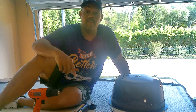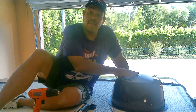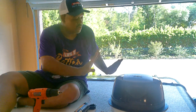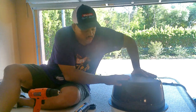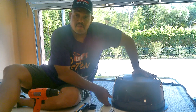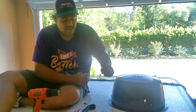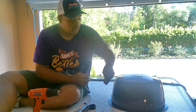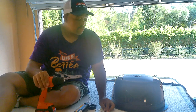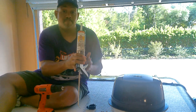I ran a test and it's working on the inside, so that's all good. I went ahead and put it down — rear and front is marked on here, so we're going to abide by that. The tape is down on the surface of the roof, giving it a nice seal. It has six screw holes and I'm going to screw this down with my drill, then caulk it with the Dicor lap sealant.